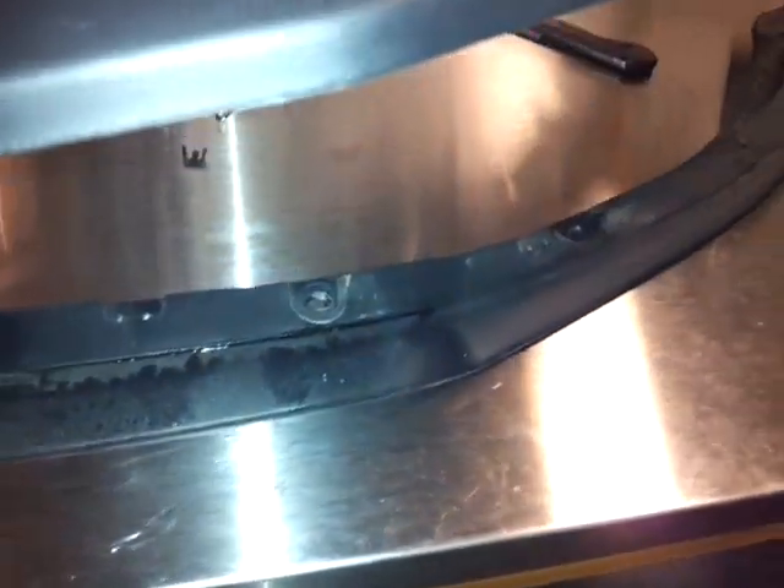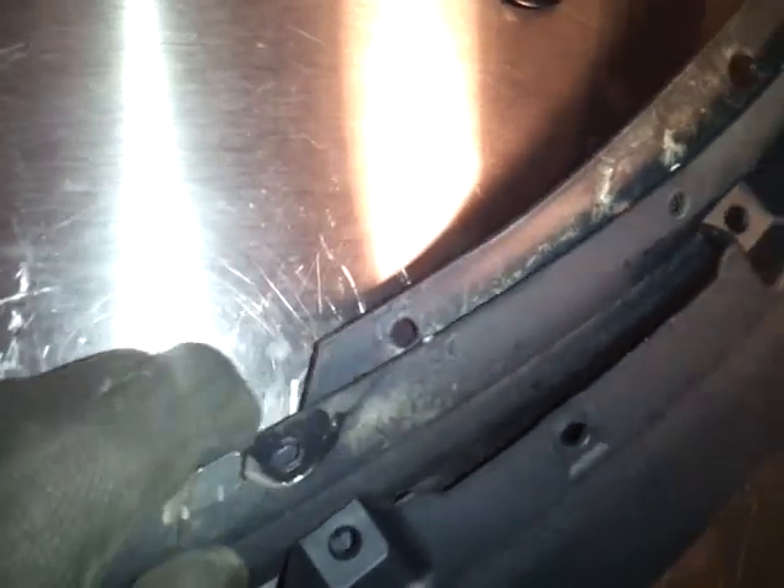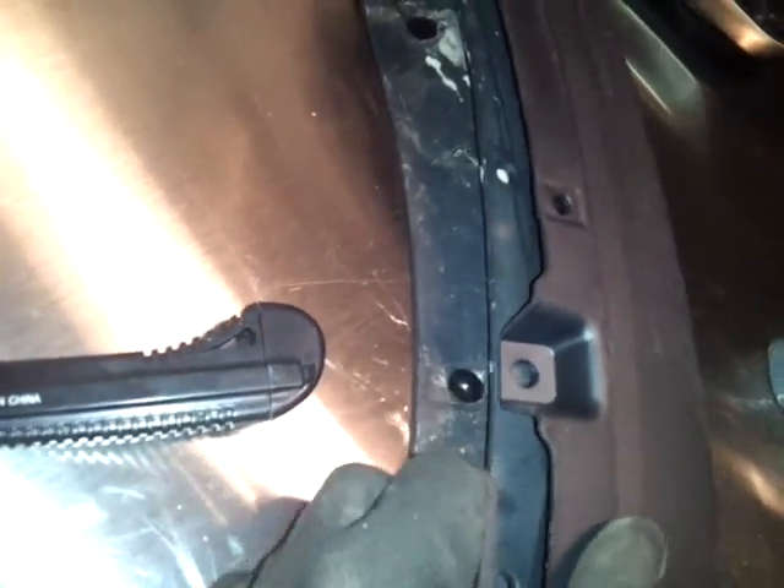Now what we did was take the Roush spoiler and put it right on top of the stock Mustang spoiler. This is what they want you to do with this spoiler — you see where it's indented to put the bolts in. It rests on this piece over here on top, so you have to put the bolts through there, but this little groove in here blocks it. What they want you to do is cut over here — all of this — so this will sit flush under here. See how it's sitting now; this piece blocks it, so once you cut that piece off...